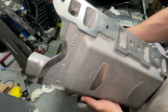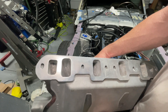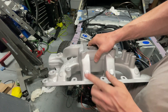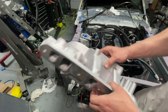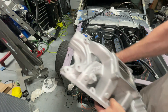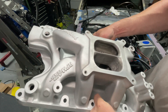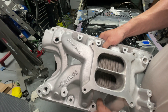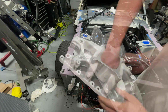When you're doing a wet air intake — which all carburetors are, basically, because you're putting wet fuel down them as opposed to injecting lower down where it shoots straight into the cylinder — you don't want them to be too polished. These dual plenums are tricky to reach into with a six-inch mandrel and air tools, so better tools than mine could probably do a better job.